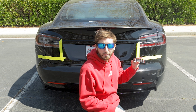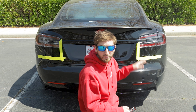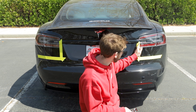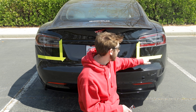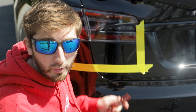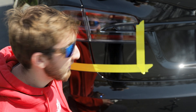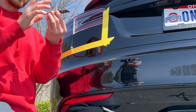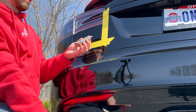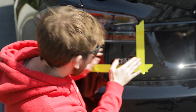Now we're getting ready to do the SpaceBalls badge on the other side of the car. We want to line it up in a similar location as our Plaid badge, so we've set up masking tape using inch-and-a-half wide tape — running a vertical line down from the tail light by the reverse light, and along the bottom body line. We're going to place the badge right in that corner. First, clean the area with wax and grease remover and make sure it's completely dry. The SpaceBalls badge has 3M tape on the back — just peel the red backing, line it up in the corner with the tape template, and give it a nice firm press.